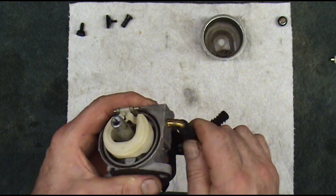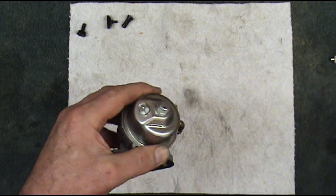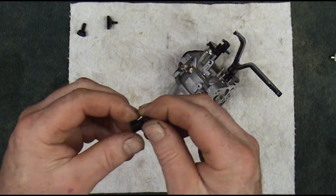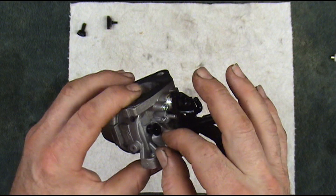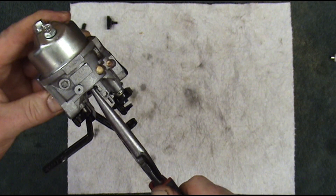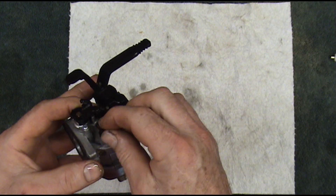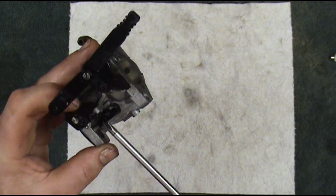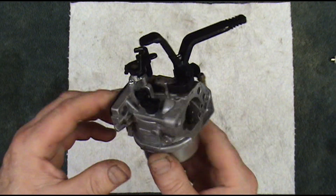That's plenty good enough to keep the carburetor from flooding. We'll go ahead and set our bowl back on — this is a 10mm. We've got our new o-ring; this little black jet has a little o-ring at the bottom that we've replaced with a new one. This low speed jet you can just walk it back down in there. This other little piece lays on top to hold it in place, then our idle speed screw holds it all together. I'll run it in until it just bumps the throttle stop, then go three full turns. Alright, this carburetor is ready to go back on now.